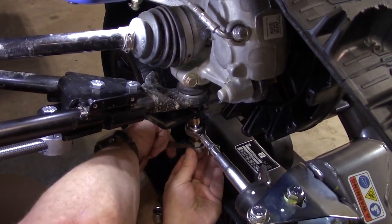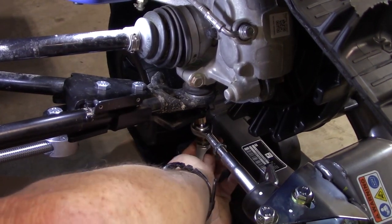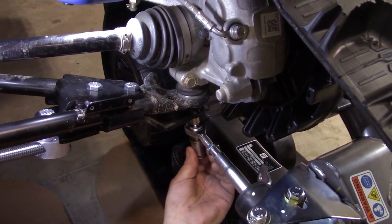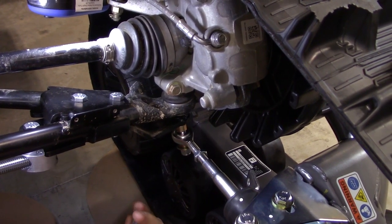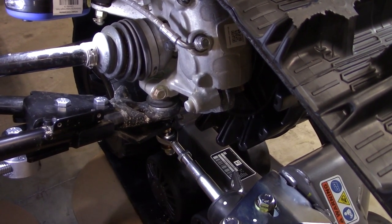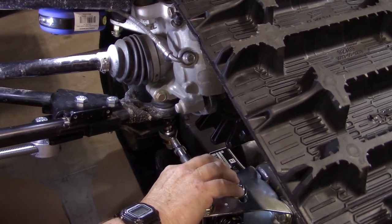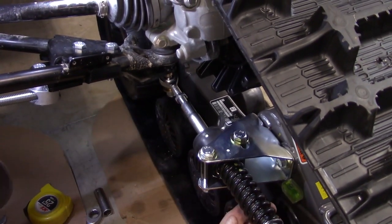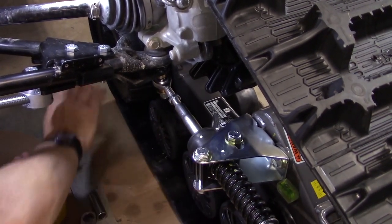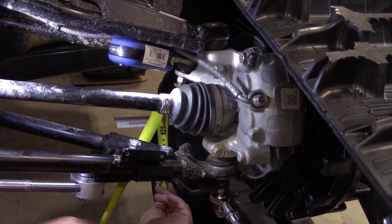I'll put the washer and a nut on and give it a couple turns. Now I'm going to tighten this up. Now I'm going to remove the jack. This swivel here was not tight — these bolts here. This rubber here, if I lift up and down, it should be just touching the rubber. It shouldn't be squeezing the rubber. Now if I measure it again, I'm at twelve and a half — a little high.